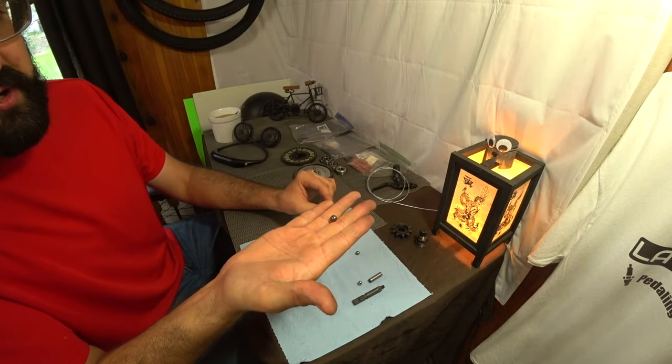All these kits come with two springs for the clutch assembly. The outer spring is a heat shield that protects the cable sleeve from the motor's heat. The inner spring is a return spring for the clutch arm. Under normal circumstances, so long as the parts are thoroughly greased, you don't need the return spring. I don't like to use it because it adds fatigue during long rides by putting too much resistance on the clutch cable. However, it does technically add life to the clutch cam and bucking bar by forcibly returning the clutch arm to the neutral position — though if the arm is not adjusted to neutral anyway, the spring doesn't help.